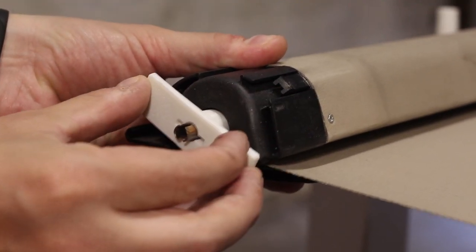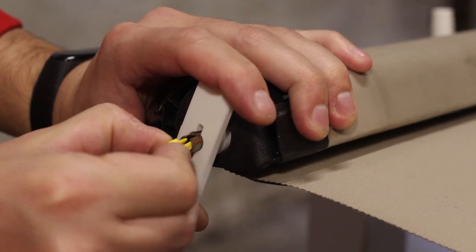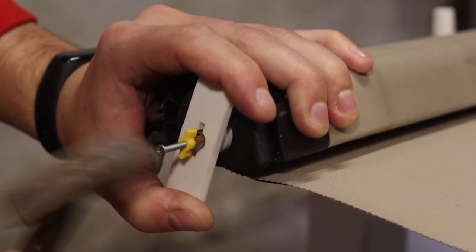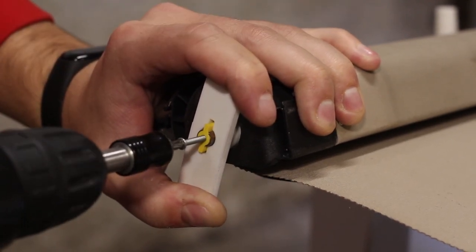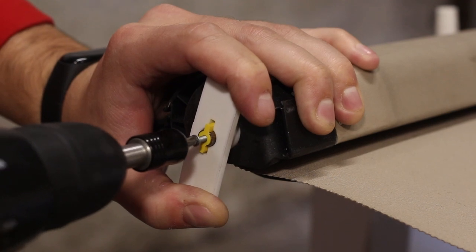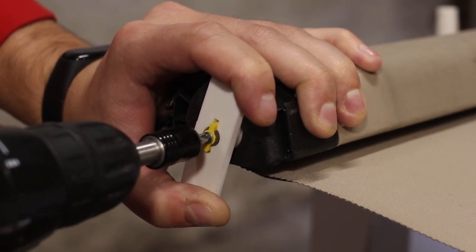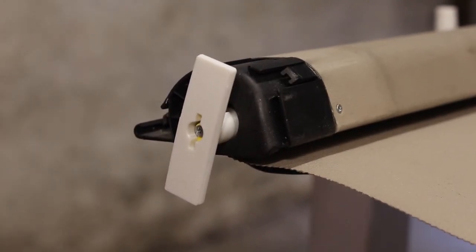Grab the new spring tensioner — this is the big T-shaped thing — and put it on the rod. Push it on and put the small rivet in the center of the rod. There is only one way you can put it. You can use the original black ones if you wish, it will also work. But I always use the colored ones I send in the repair kit. If you mess something up, it's very easy to take it apart again, and if you lose the center part, you don't have to find anything that matches the hole.